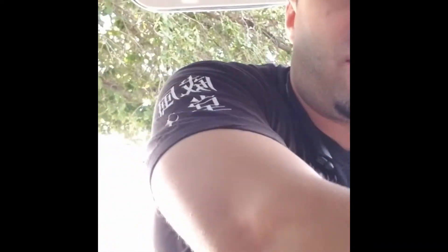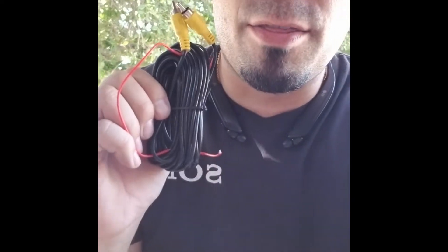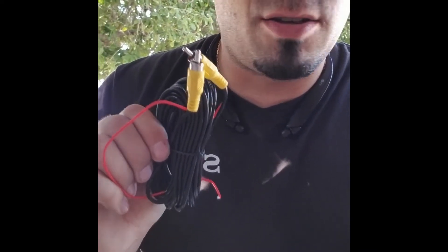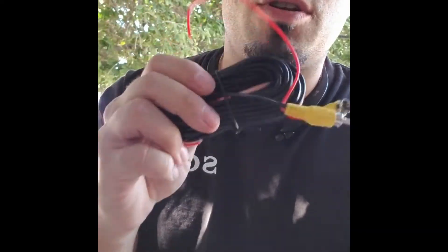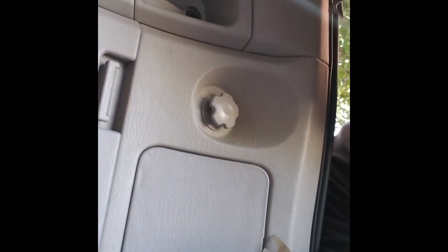Purple is your parking gear wire. This is your reverse wire output. You need to keep in mind there's only so much milliamperage output to activate your camera. I'll go over the mathematics and the science with everybody, but there's only so much amperage that can travel through the resistance of a wire. Over 300 feet you'll obviously have problems, but usually it's not a bad thing.